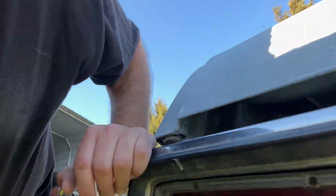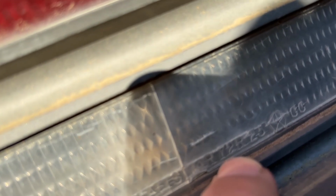And then another thing you can do is you can go to the tail lights. They would cast in the year of the car. So you can see that says 72 right there. The only problem with that is on some of these cars, the tail lights will fit each other. So like a '71 and '72 might be able to swap. So that's not really a good safe bet either. But your foolproof bet for figuring out what year the car is, is the VIN.